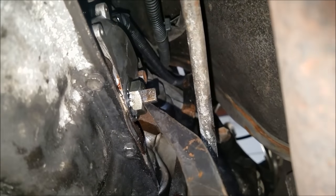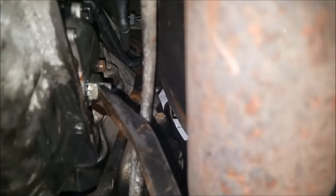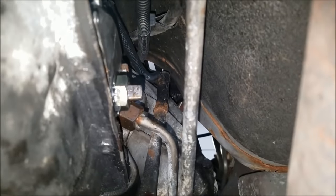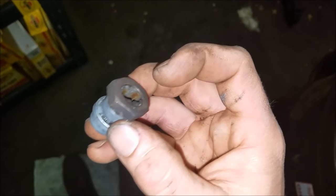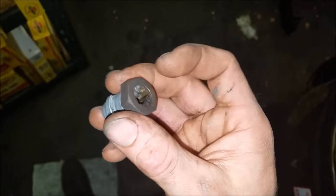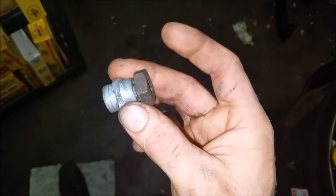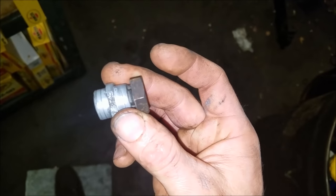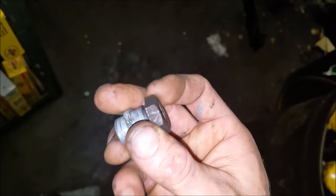In conjunction with tightening that top nut down, also come in here with a pry bar and push on the exhaust to seat that all the way down. Tighten your 22 millimeter nut down, bend those tabs over, and you're done. The biggest challenge of the job is getting this to slide off that shaft. When putting the new one on, make sure to clean that shaft up real good, sand it down, get all that corrosion off so the new one slips on fairly easily. Also definitely grease or put anti-seize on that shaft as well.